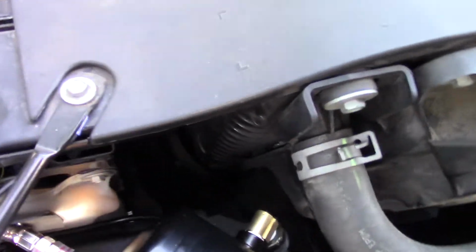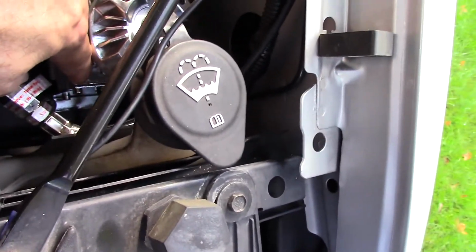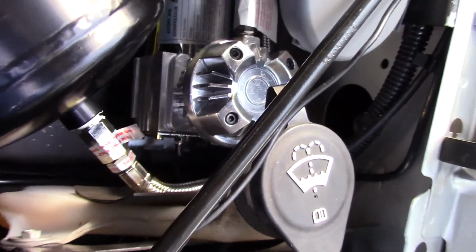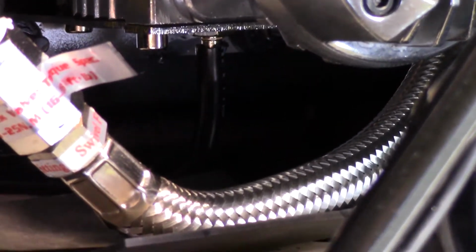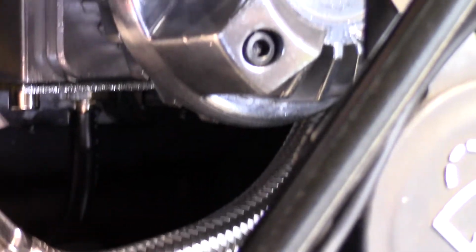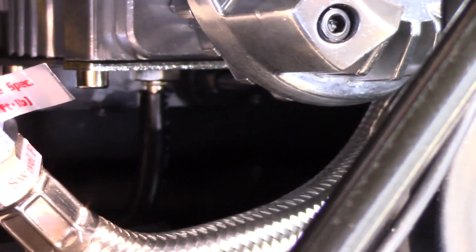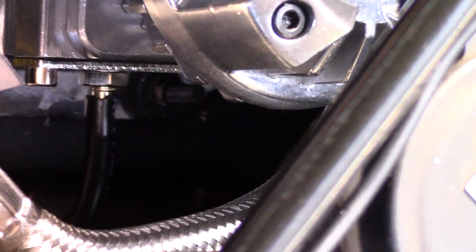And I don't know if you can make this out on the bottom of this. Not really. But on the nose of this air compressor right down below, I'll try to zoom in. If it focuses, it's a real sharp bend in it right there. So you're going to have to use that same match trick and warm up the plastic and form the right angle bend you need, and then hold it in that position, let it cool off, and it will retain that new shape.